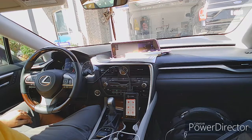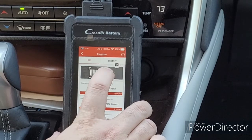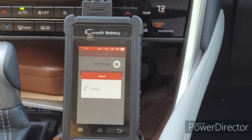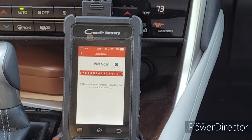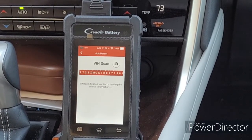So that was the battery test. Now we're going to get our OBD cable, plug it in, screw the little screws, and we'll go do a scan. System scan — very simple. Plug it in to diagnose. Auto detect. Anything newer than 2008 should pull the VIN with no issue. There are a few weird models, like a 2012 or 2013 Jeep Patriot or FCA — just, I don't know, felt like being FCA.